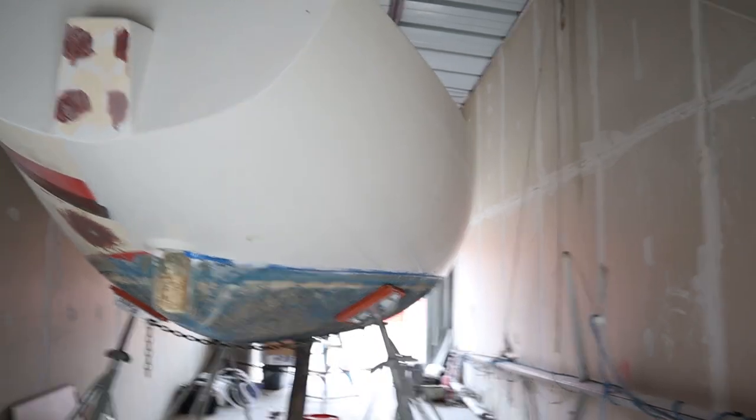It's been three hours since I put on the first final coat and I think I'm going to go over it one more time. Man, it really is just glass smooth. There are a few tiny spots but it's really shiny and smooth. I've still got to wet sand and buff this but it really looks nice. I'm going to put one more coat so I have better coverage — there are a few spots where I sanded through the primer and I want good coverage, since wet sanding will take a little of the surface away.